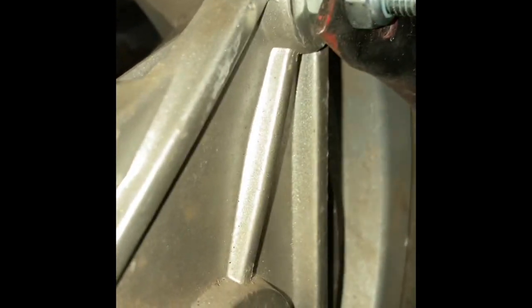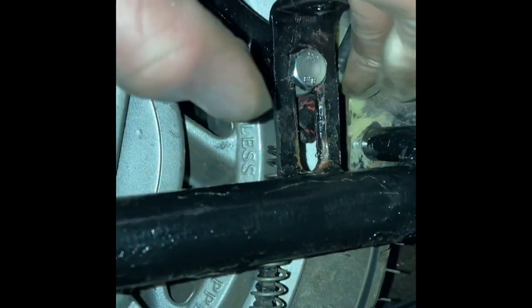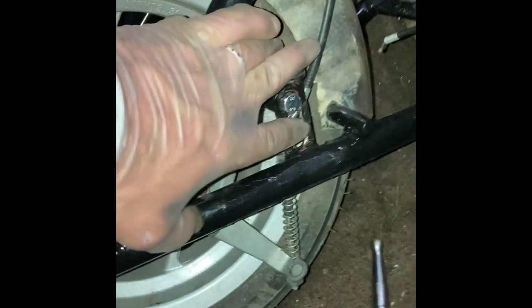This is so clean — all I had to do was put in an M8 bolt, put an M8 nut on it, and a locking nut on the other side of this piece, then do the same here. I put a little spacer in the middle of this one, then hooked up the rest of the stock brake line — I didn't have to change a thing. I took this bracket out, readjusted it down here, and now when I hit the pedal the brakes work. The line goes up here, kind of hides itself in the body — really slick.